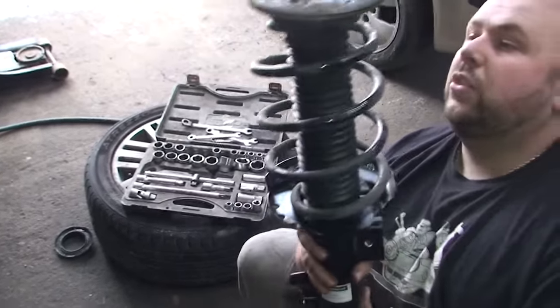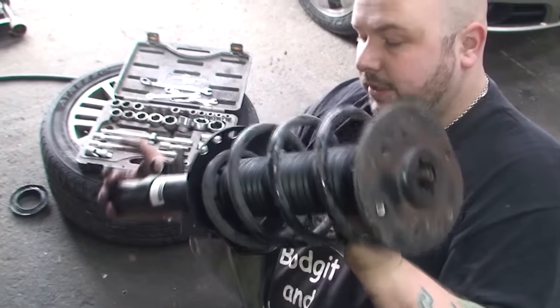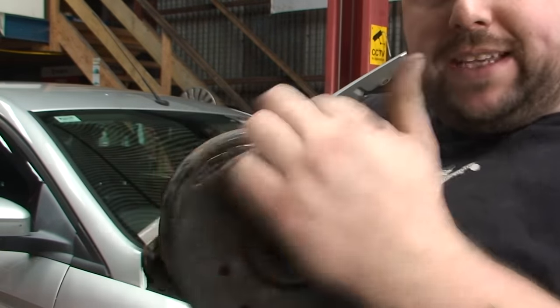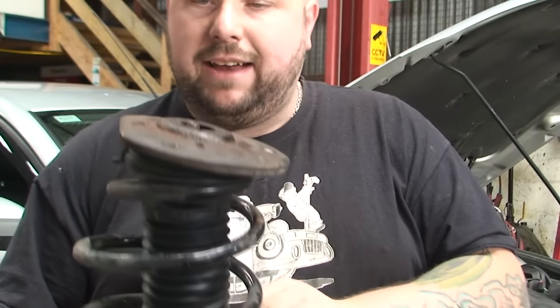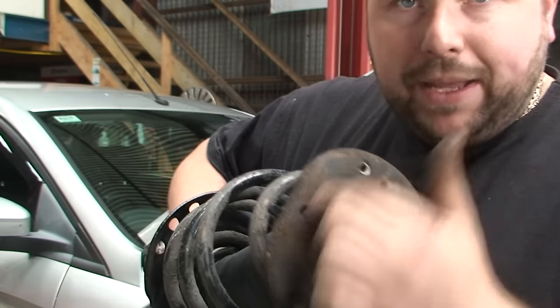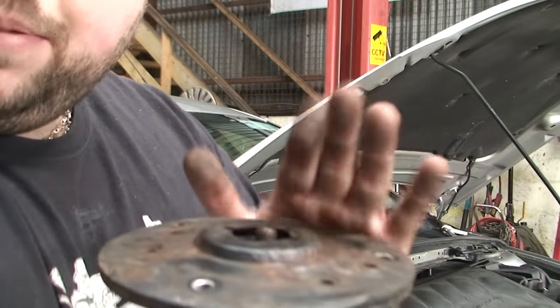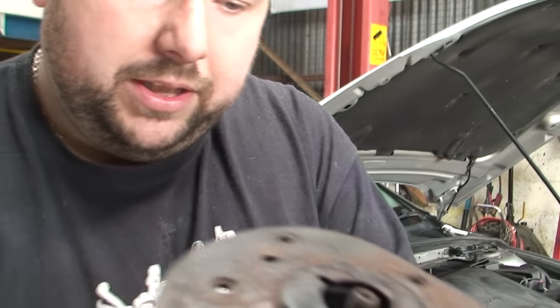These are all genuine Ford parts, which we're putting in this car. That is one shock unit complete. When you're ready to put it back in, make sure you have a straight edge at the top - it's not perfectly round, there can be a few different shapes. Make sure you get this in the car the right way, because otherwise you can affect your steering angle. On this particular car, the flat bit goes in towards the engine. I'm going to shove this up, put the three bolts on, then turn the camera back on.